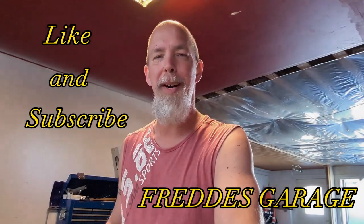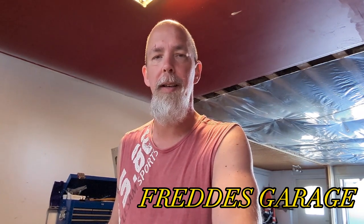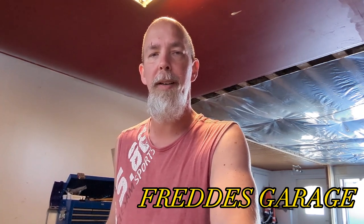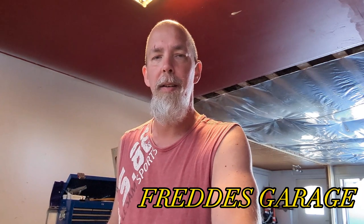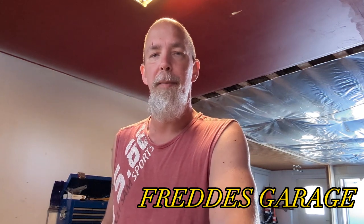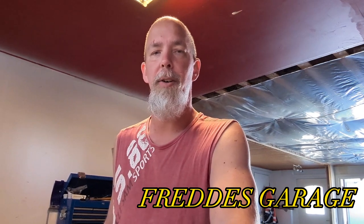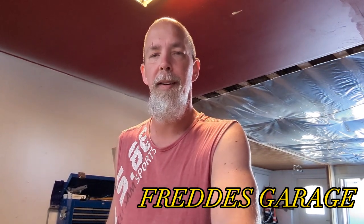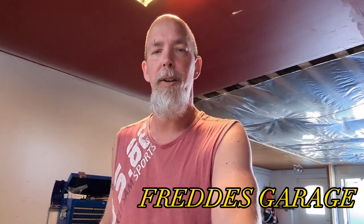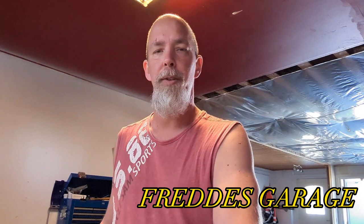Hey guys, welcome back. Today we are replacing the engine oil and oil filter on this Toyota Auris Hybrid. And first of all, you want to take the car for a short spin around the block just to heat up the engine, makes draining the oil a bit easier. After that, you want to jack up the car, put her on jack stands, or in my case, I will be using ramps.